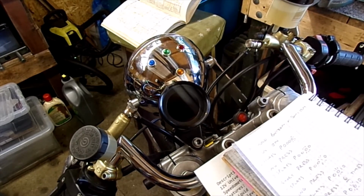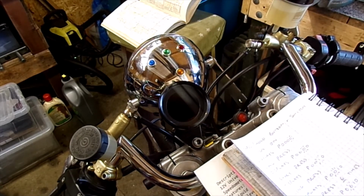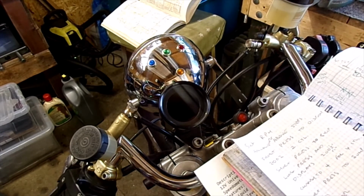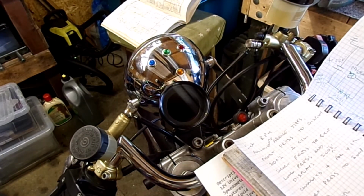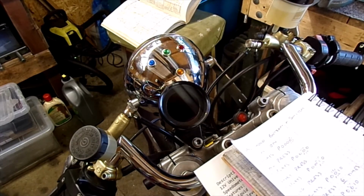Yeah, I wonder if I change that, because I think that might be getting 2 lots of signal on that. I wonder if I change it to a 4, as if it's a 4-cylinder, whether I'll get a more accurate reading. I'll try that. In the meantime, I'm going to have to charge this up because the old battery is getting flat.